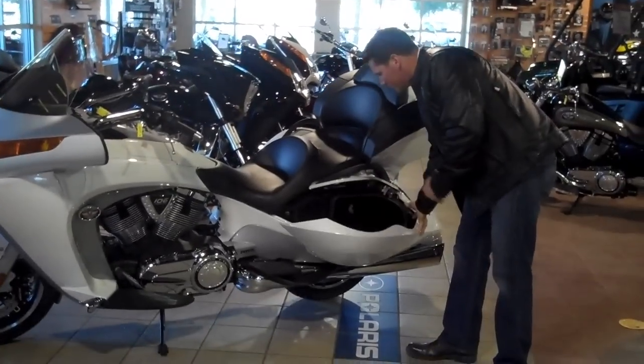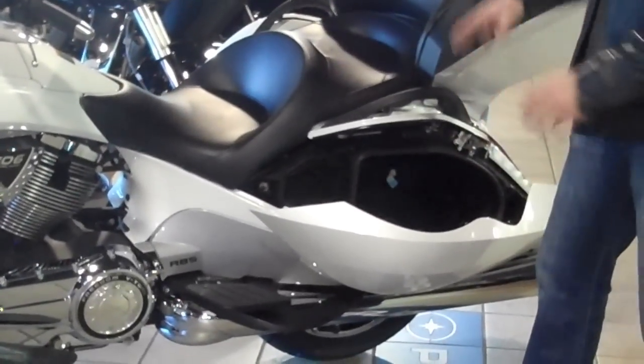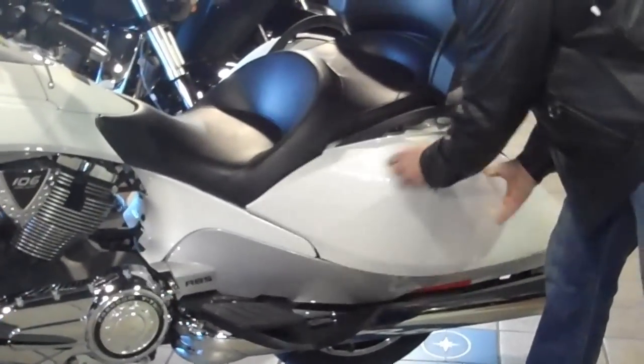You've got great storage on here, and you also have air suspension in the back. There's a little Schrader valve right here and a little chart for how much weight you're putting on, so you can gauge what you've got between two people and all your gear — making sure you're riding at a safe ride height to handle any obstacles you might encounter.